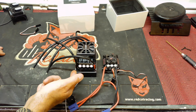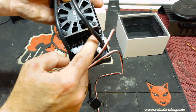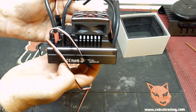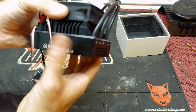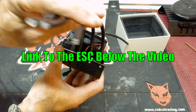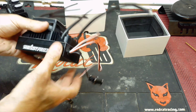Just check out the quality of this thing. It's fully engineered, absolutely awesome. We've got 200-degree-rated, 6-gauge wire for the leads, no less. And handling this amount of power, you won't be getting 6.5mm connectors from the Poseidon motor — these are 8-millimeter bullet connectors. I think this thing should power the DBXLE to some serious speed, particularly when I hook it up to a 12s ESC.